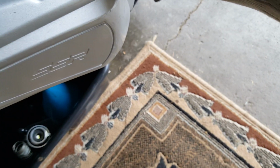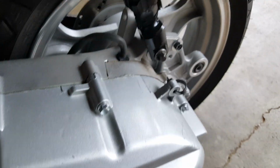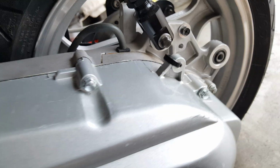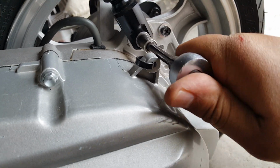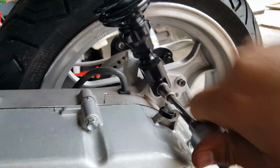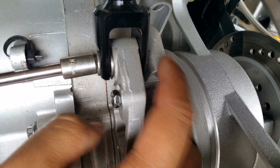Okay. Yep. You want to take off your breather crankcase hose here. You don't want to damage it. Just twist it out of the way there. Put our socket in. I think we're getting a uni breather coming in, so we can make the end look even nicer. Okay, so we'll crack this open. See there? This actually doesn't have too much playroom because it doesn't want to go too long because it'll hit this right here. So it worked out for us.